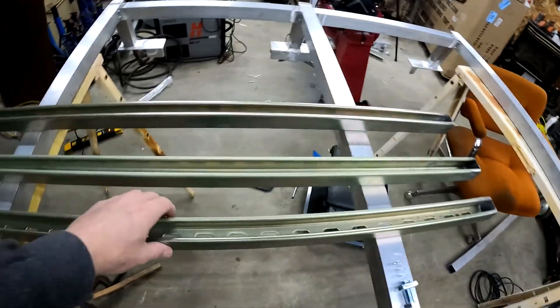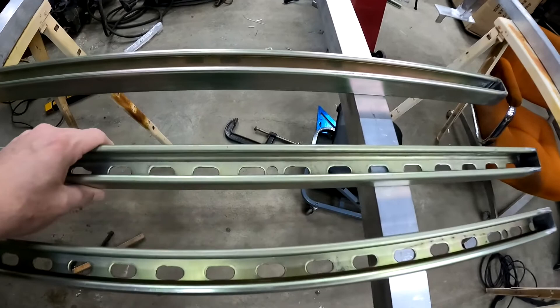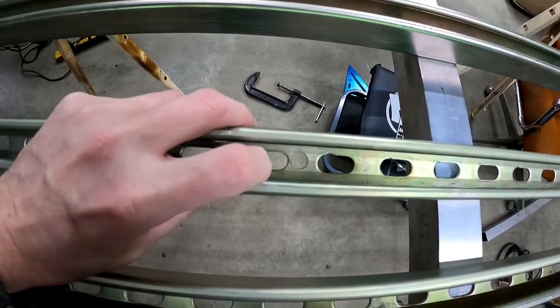I've gone and made mine for the most part. I've cut them to the right lengths. You will have to drill holes because these holes don't line up with all the holes in the bed of the Jeep — they already have holes pre-drilled for where your stock bed rail system would go. They're threaded M6 bolts. I cut all three of them already and welded caps on the ends.